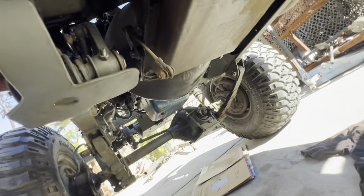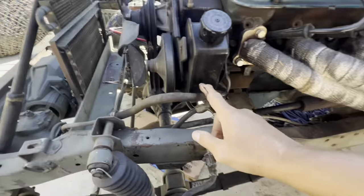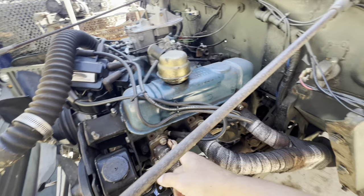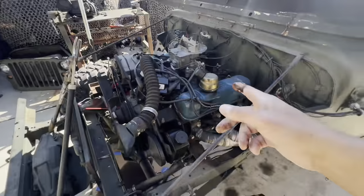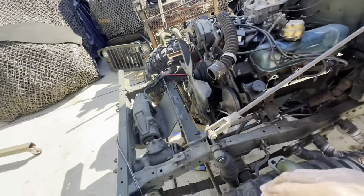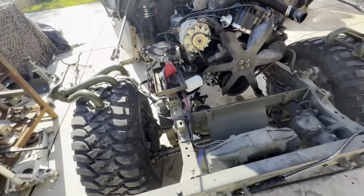Anyhow, got a few things that gotta go. I gotta do this other side - gotta take off these lines, fuel line, and take this off. Take these bolts out, and then I gotta unhook the carburetor, pull this off, put the plate here, get my hoist, yank it right on out. So we're at this side right now - just cut off this front piece right here, grind it down, and you'll never even know it was there.